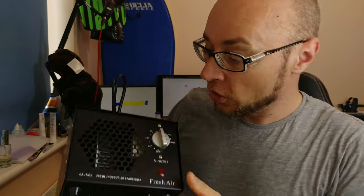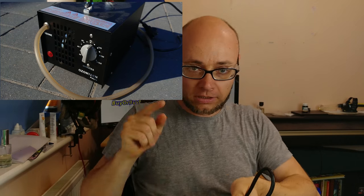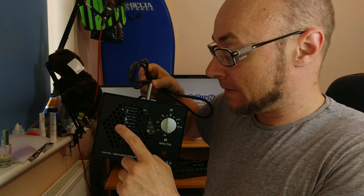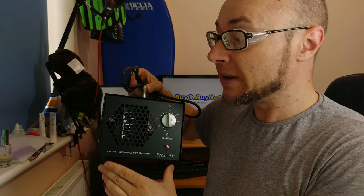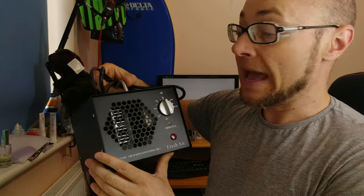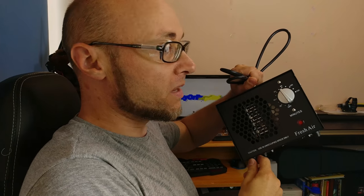It would get more if I hadn't seen the ozone generator owned by a friend of mine. While on holidays I found an ozone generator not as big as this one — maybe half the size — but it had a small pressure pump inside, so you could technically pump ozone underwater or into narrow spaces. That pump is missing in this device. This unit has more power and produces around 5 grams per hour, while my friend's device was producing only 1.5 grams, so it was not as efficient. That said, you don't need such a big unit — 1 to 2 grams per hour is more than enough to ozonate a room or a car.